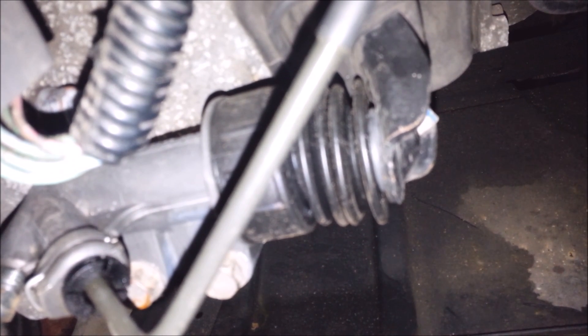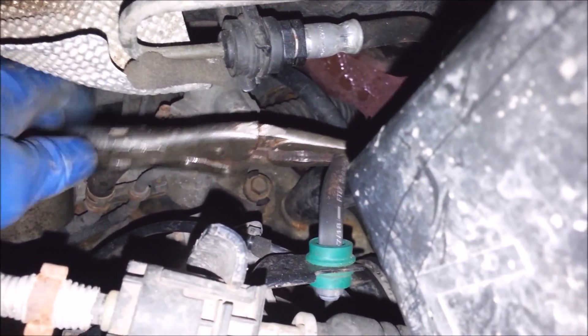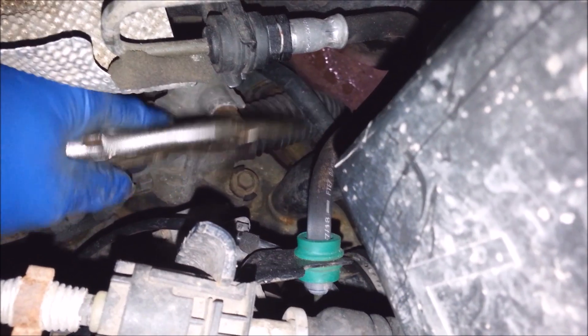Now if I look down here I can tell that the slave cylinder actually pushed out, disengaging the clutch — you can tell the rod is longer because that rubber bellows boot is spread out more. So you know the piston rod in there moved out. It's stuck out because of that vice grip. I pulled the pedal, and now this air is still in the master cylinder and has no place to go but up, so I just take this vice grip off.